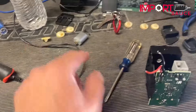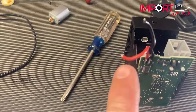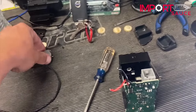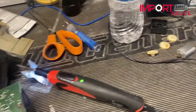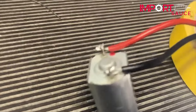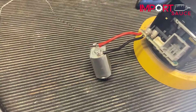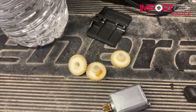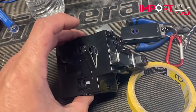With the donor motor out, we take our wire snips and strip just a small amount off the leads — about the same length that went through the hole. Then we drop fresh solder on there with the iron to reconnect everything. We do a tug test and those connections are solid. Now we'll flip the motor back in, screw it down with those two little screws, put the gears back on, put the gear door back on, and enclose it all in the housing.